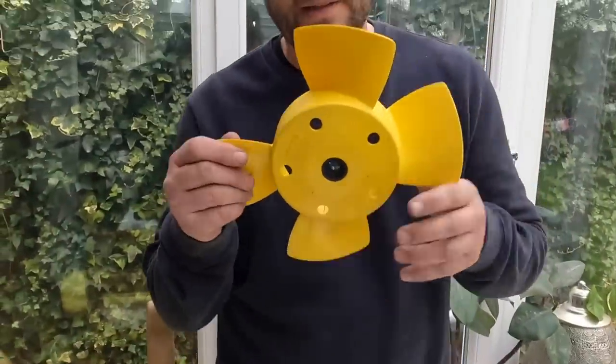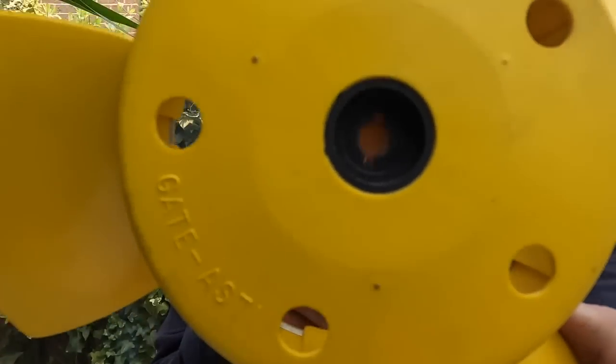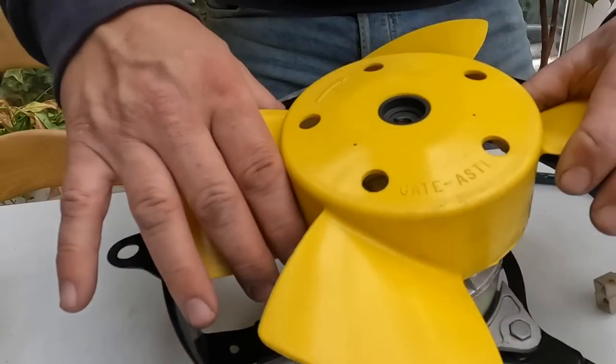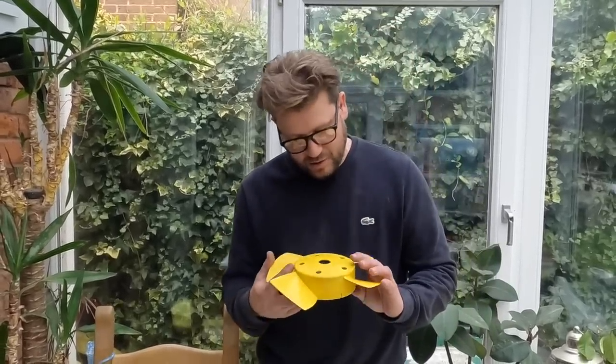Eventually I managed to find this — a yellow fan from Ferrari in America, shipped across for about £200 with shipping. They do still make one of these from Ferrari, but the upgraded part they use now is a black one. We want originality with this, so we got the yellow one. However, it's still not 100% correct — the outer size fits in the housing perfectly, but the hole in the middle does not fit on the shaft. Not exactly sure which Ferrari this came from — it was advertised as a BBI part — but there are no more available. Ferrari do not make this part; this was literally the last one we could find. So we are going to try and fix it.